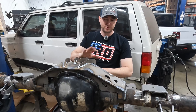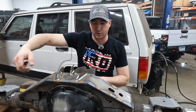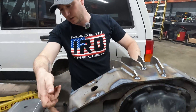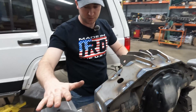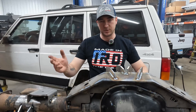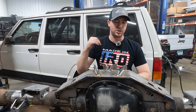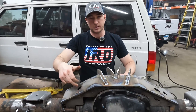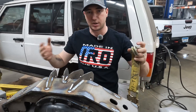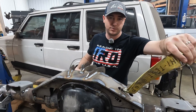Our truss is fully welded. We did some stitch welding underneath — if you feel better about full welding it you can, but do it in sections; don't just start at one end and work all the way to the other. All of our upper control arm mounts are welded inside and outside all the way around. We left all of our spring pads, lower control arm mounts, and shock mounts tacked, so once we get this in our project if we need to make some adjustments we just cut a couple tacks, adjust it, and get it fully welded. That's a lot easier than welding a whole truss underneath the Jeep. Last thing — on our truss kits we have cutouts in our top plates designed for the bigger two-inch double hook straps, so instead of messing with old wheel straps or full axle straps, they'll drop right in, hook it up, hit the road.